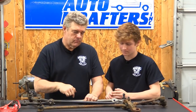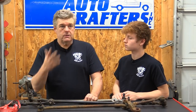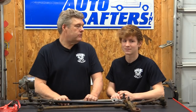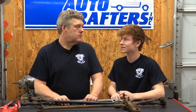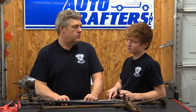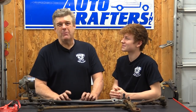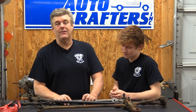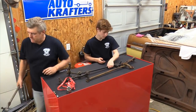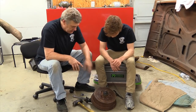I'm going to pull the front spindle back up and look at some of the things we need to make sure of when putting a set of these spindles on a car, because they are ancient — 1964 to now is a long time, like 55 years. Possibly worn out. I'm going to show him how to take a spindle apart — take the drum off so we can check the actual spindle for condition. Get that cotter pin out. You need to take that retainer off so the nut underneath doesn't walk around.